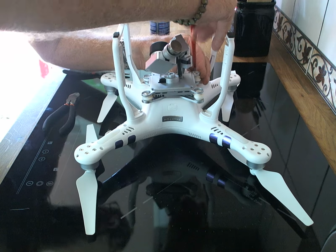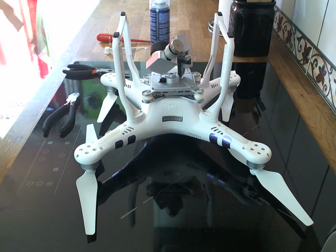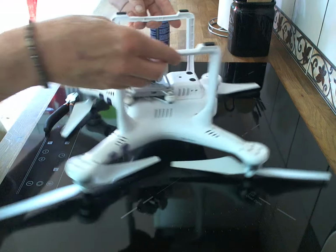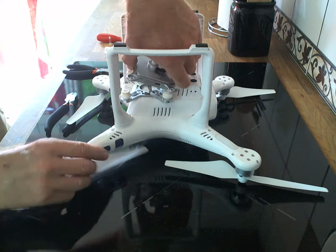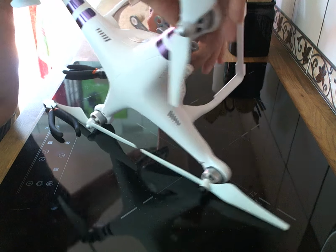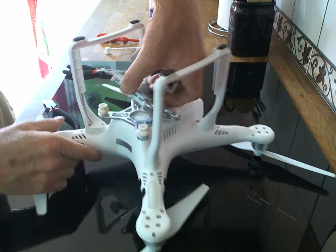Now, this issue of video lag, it is very, very dangerous. So this will address the problem. Okay, so with all the pins out and the shock mounts there, we need to disconnect now the gimbal by the two wires, the two fixing pieces there. I don't know if you can see them, the cables that fix to the gimbal. We need to take them out.